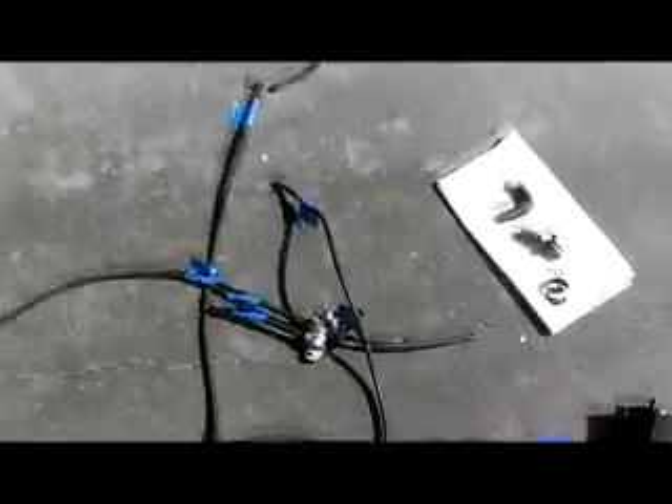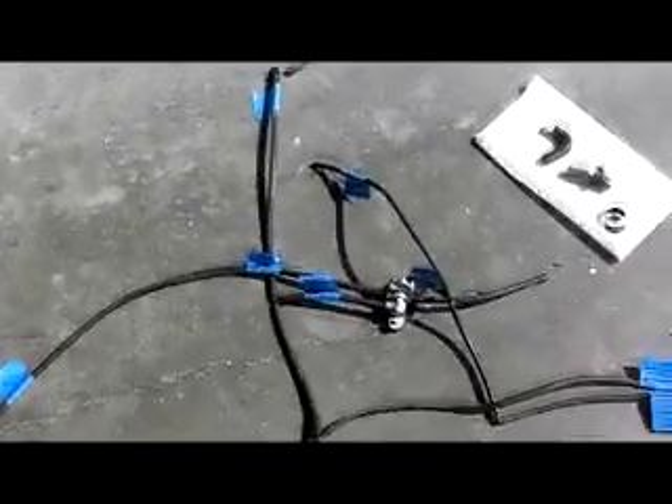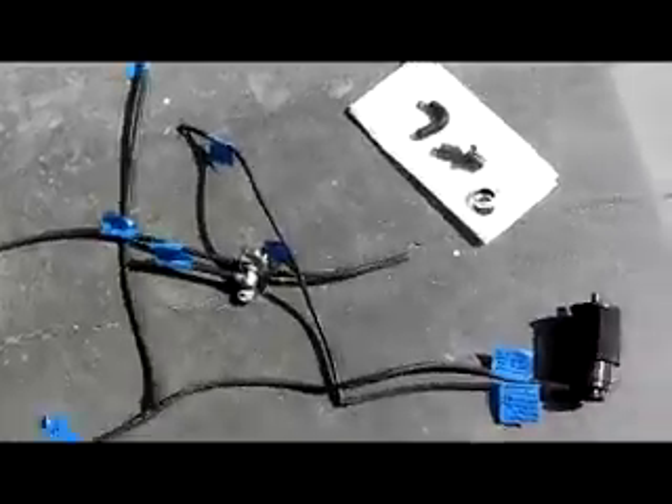This is what came off of the KTM 530 EXCR with the pollution control removal. We have the evaporator canister here. This nipple just went to nowhere — I guess it draws atmospheric pressure. There are two markings on the canister: one is 'purge' and the other says 'tank'.